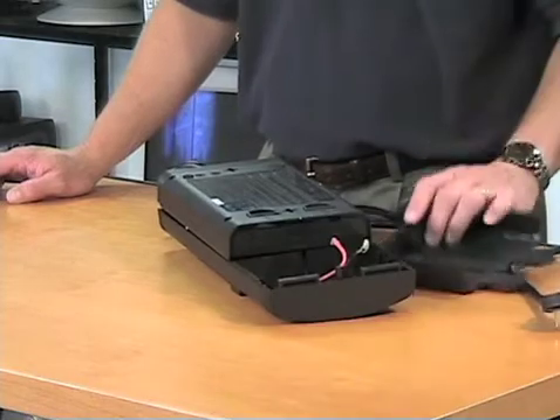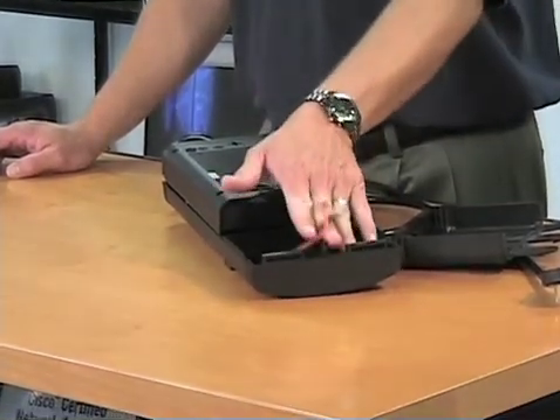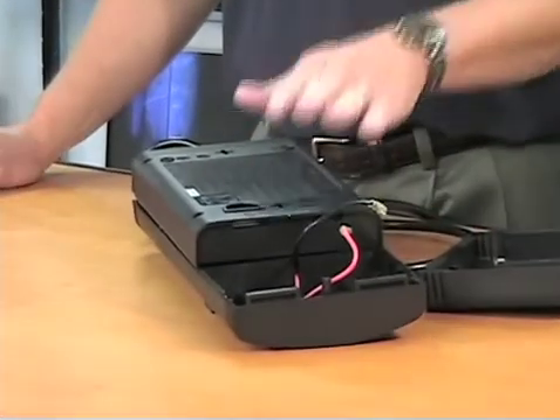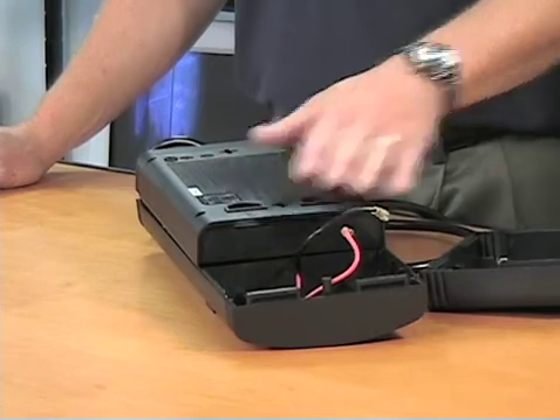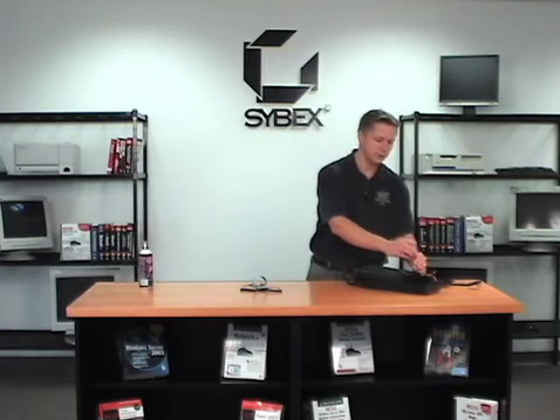If we pull it apart, you'll find a 12-volt battery inside. This 12-volt battery has only two wires — positive and negative. The third wire on an outlet is for ground, but the battery doesn't have a ground anyway. The battery is really the only serviceable component. Batteries are usually only good for about two years, so every two years you need to replace them. A good UPS will start beeping and letting you know well ahead of time when it's time to think about a replacement.